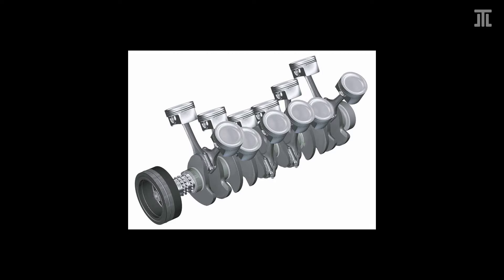BMW states that the crankshaft on the N74 is 100 percent balanced. In contrast, Mercedes describes the crankshaft on the M279 to have a, quote, high balancing rate that is just over 50 percent rotating. This is a strange choice and indeed a strange description, as a 50 percent balancing rate is not high and is bad for both performance and durability.